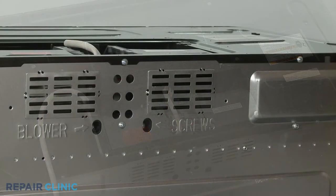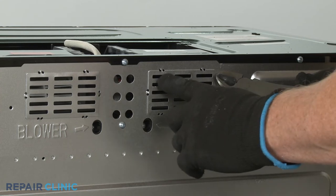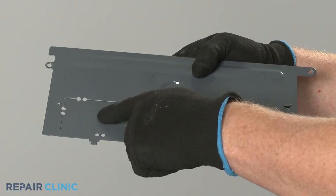Be aware you will need to use wire cutting pliers to snip out the damper vent covers on the rear of the microwave when preparing the appliance for wall venting. Or, snip out the vent covers on the damper plate for roof venting.